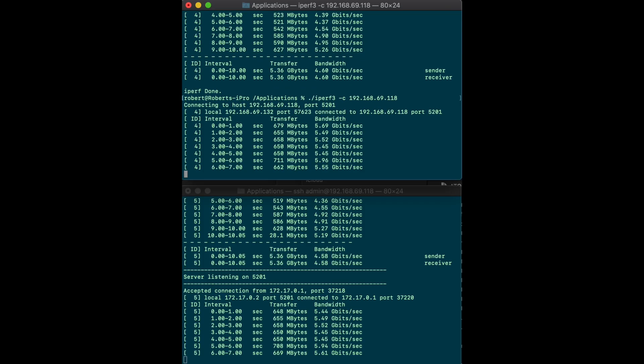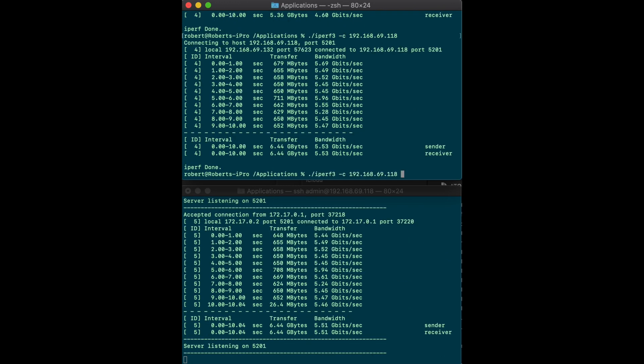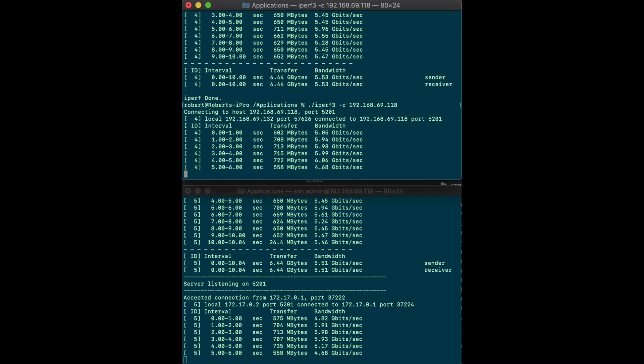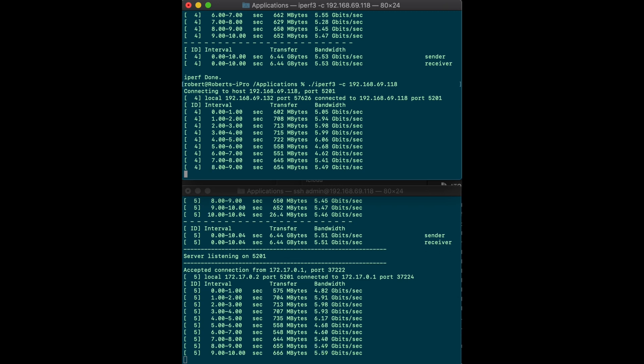There are a few more things to note about how the actual network testing is being done. I discovered that it's not just read/write performance we need to look at but also the raw network speed and throughput. I downloaded and installed a tool called Iperf3 on my Mac and also on the Synology. Iperf is a command line utility commonly used to test network speed. To use it, you need to know basic terminal commands as well as how to use SSH to remotely log into your Synology NAS, since you run Iperf from both devices simultaneously.